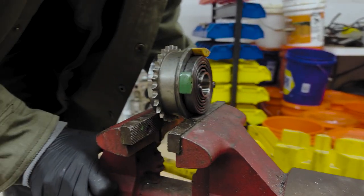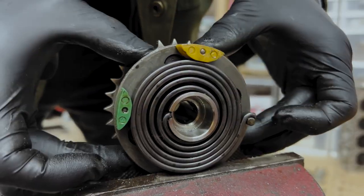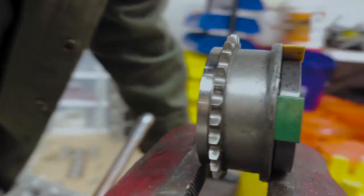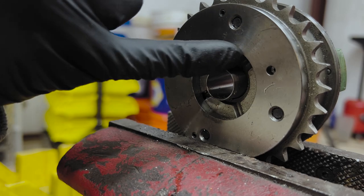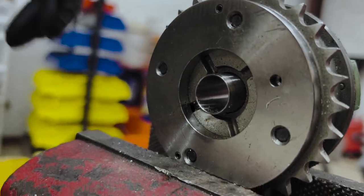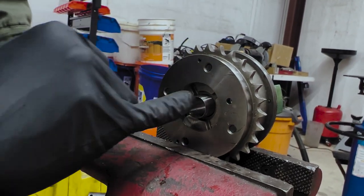To describe how this unit works: this is a spiral spring, and this unit inside here rotates independently from the outside of the unit. This is controlled very cleverly by hydraulic pressure — oil pressure. Oil comes through around the bolt and goes through those passages you see there into internal cavities, when commanded by a solenoid, which allows the center section to rotate independently.